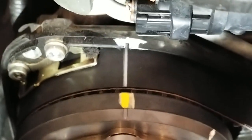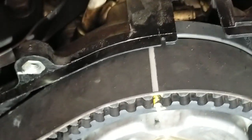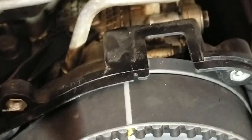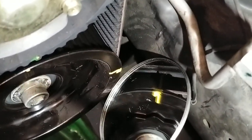You can see the center is perfect. The left cam — aka the right cam if you're being proper — it's perfect. And let's check down here with the mirror. That down there is perfect. But when we get over here, what's the deal with that? This scares a lot of people when you do the timing belts. This appears to be off right here, and down here that is just about perfect.